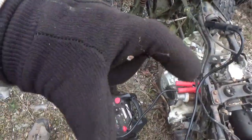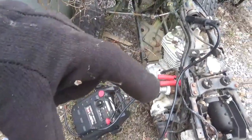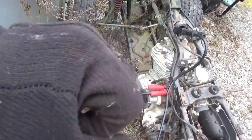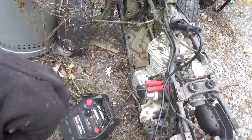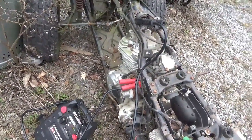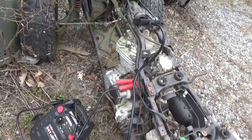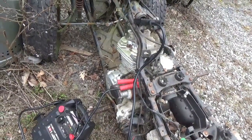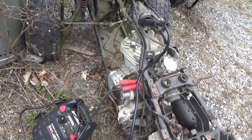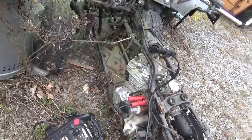because the stators are bigger. So if you put the wrong flywheel on it as you're tightening it up, it gets seized. It becomes a press fit. And if you go the other way, you have too much spacing between the flywheel and the pulse generator, and they don't run right. So you got to match your flywheel and stator.